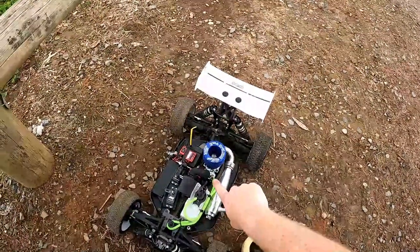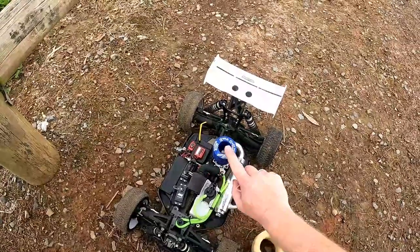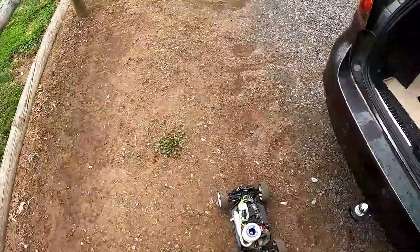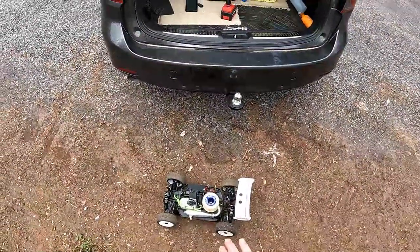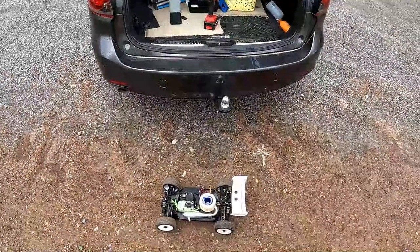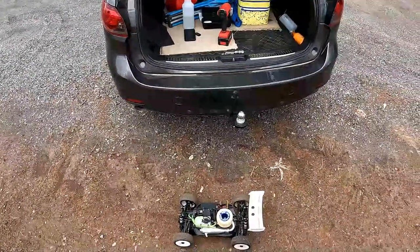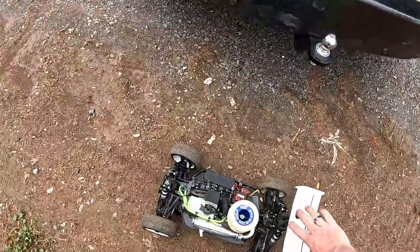And what we're going to do with tank number three is lean the main needle a little bit, not a lot, just a little bit, for the next tank. All right guys, so it's going to be more of the same thing. What I've done is I've leaned it just a bit more than an eighth of a turn, and we're going to do this for the next three tanks.